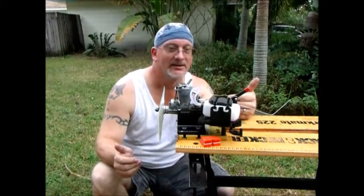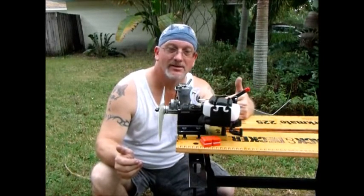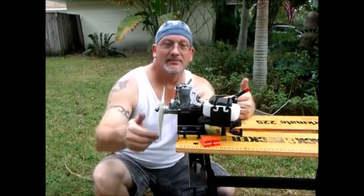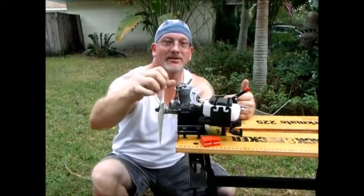I like to go about 800 to 1,500 RPM or so below peak on the ground so that you can compensate for leaning in flight. But you can see that's a pretty darn nice running engine. When it cools down, I'll fire it up and run it again.